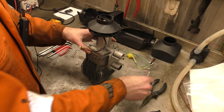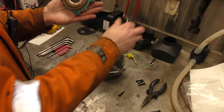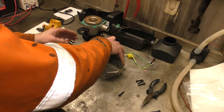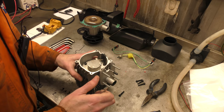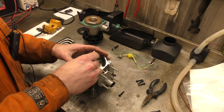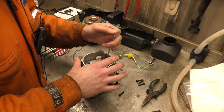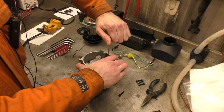And that should give us the burner chamber. This came off with the gasket absolutely still intact — not a problem whatsoever. So you would just put that straight back on. Okay, that lets us into the burn chamber. This burn chamber's actually got a nice gasket. The other gaskets I've had for burn chambers are just like these green ones here. This one appears to have a metalised-style gasket.